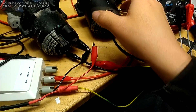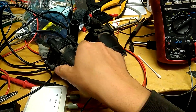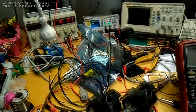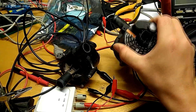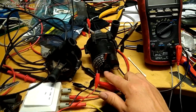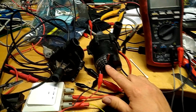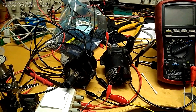Also, here's a curious footnote: the coolant pumps from a 2015 Tesla Model S seem to be the exact same unit as found in the 2012 LEAF. All the plastic moldings seem to be exactly identical. I've done some testing with the Pacific Line signal generator, and they behave damn near identically. The pinouts on the connectors are the same — they respond the same to a 2 Hz PWM signal on the bottom-left pin from this direction, and they put out what seems to be basically a pass-through of that signal on the top-left pin from this view. They both respond to the same signal with the same change in RPM.